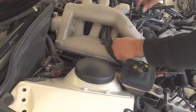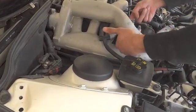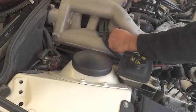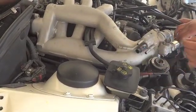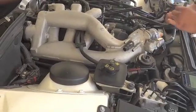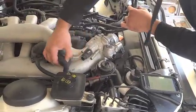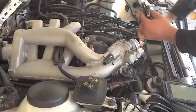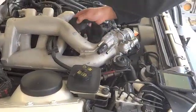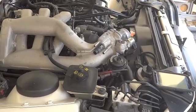These two, the one from the degas bottle right here, that's going to go under this area. Same from your radiator tube right here. Okay, a little coolant came out, that's fine. Just get the rag. No big deal. And this is the main reason why they have you drop the fluid in the radiator, because you have your whole system with these two.